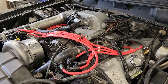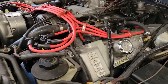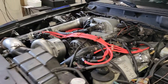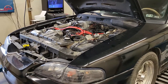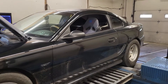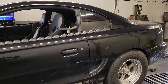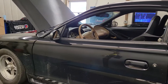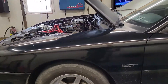We don't really know much about it other than it's got a DSS rotating assembly and these cool valve covers — never seen those either, obviously just a BBK piece. I don't know what cams are in it. It came here a while back for some baseline hits to make sure it was safe. The guys bought it on pump gas and it was like 9-something to one on the wideband — so rich it barely runs — so we actually converted the car over to E85, which I believe is what it was intended for.